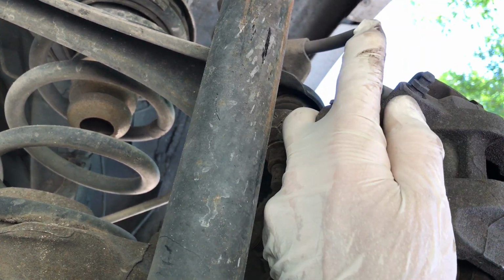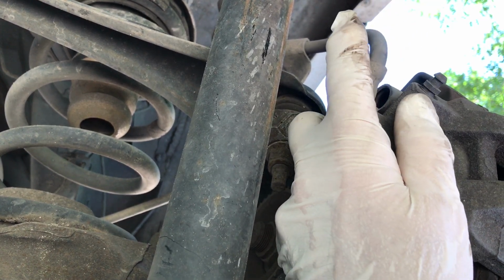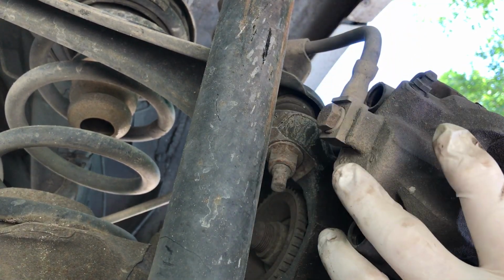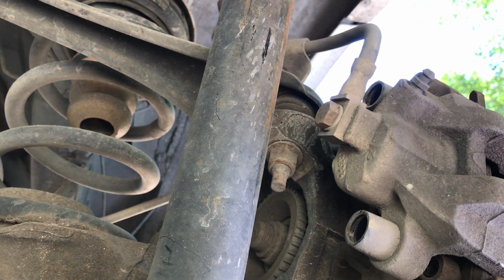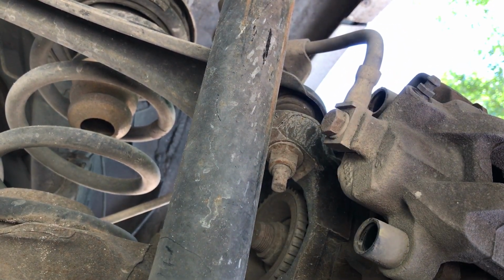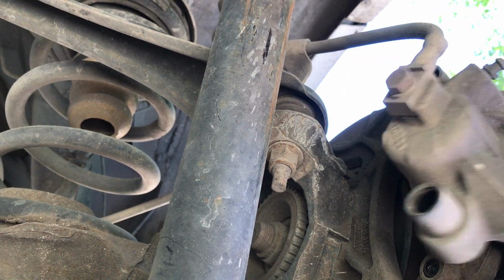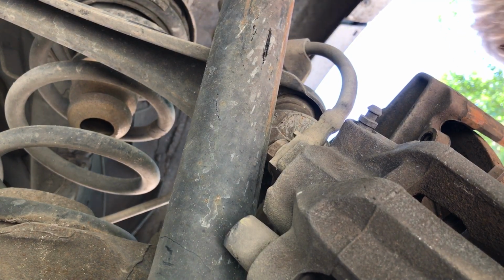Push the piston back in right now. I can do that just with this pry bar. Heck, that makes things a lot easier. Huh. Wish I'd known that on the other side. Okay. Again, I don't know what was hanging it up, but there you go.